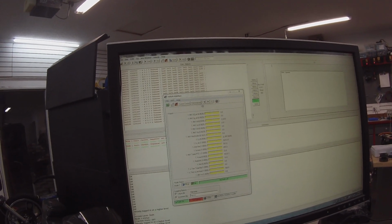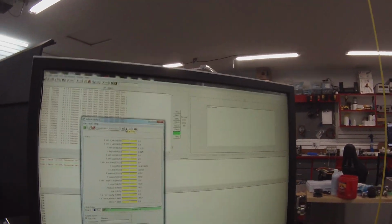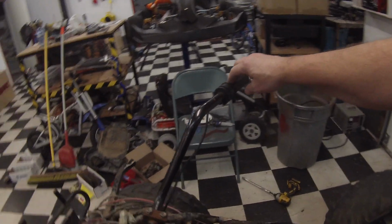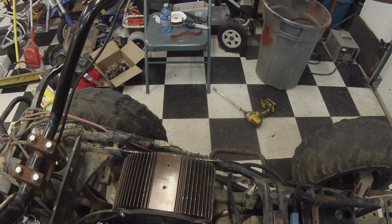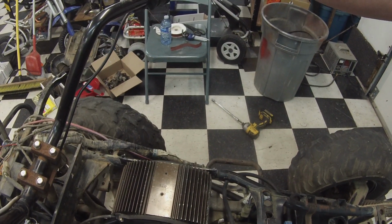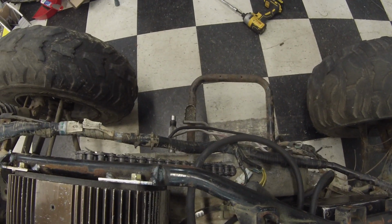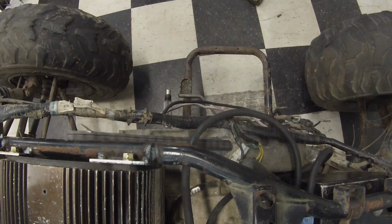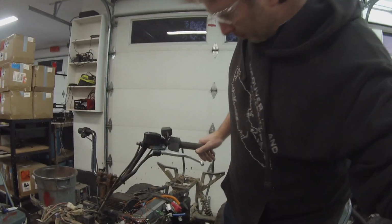Basically what this is going to do is let me graph the motor alignment, the motor encoder alignment. So what we do is we click this start trace thing. I'm just going to verify that it spins easier and slower now. Yeah, I have better control over it now. And you can hear I've got to cut the opening for the chain a little more, because where the master link comes through there, it's actually grinding every revolution of the chain itself. But it's running, so that's exciting.